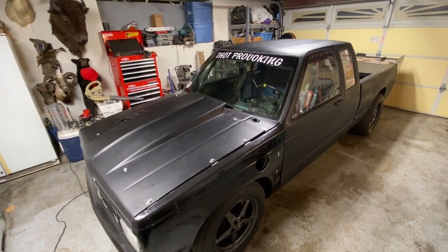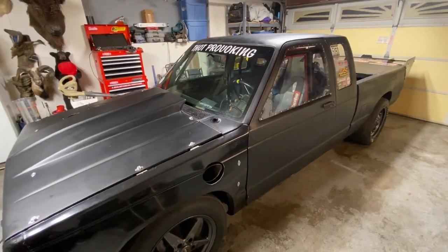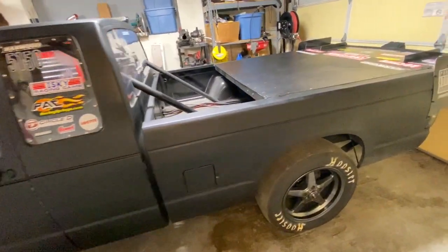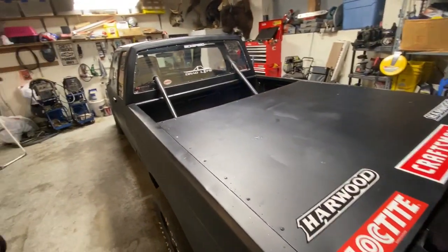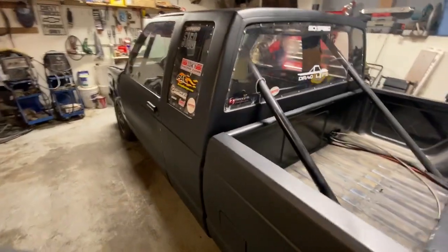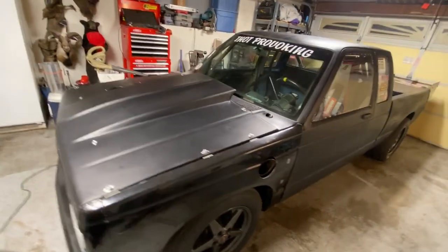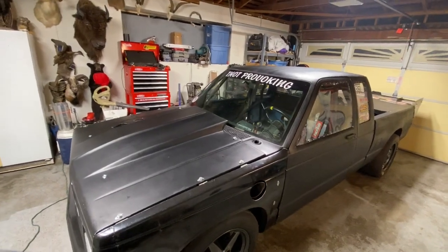And the 5.3's been good. It's been solid. I've done a lot of bad things to it as far as tuning and learning and bad injectors and boost creep and just about everything you can think of. I mean, at one point I had injectors that were stuck open on a couple of cylinders, so they were just washing them out basically, and the system was trying to compensate for that, so it was leaning out the other cylinders. But it's held up well. I've compression checked it. Everything seems to be good and healthy. The plugs show that it's good and healthy.